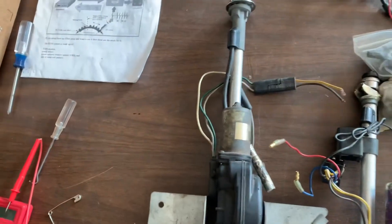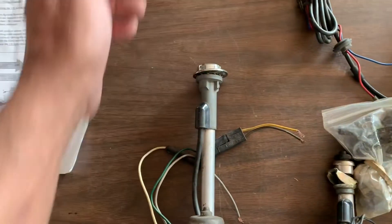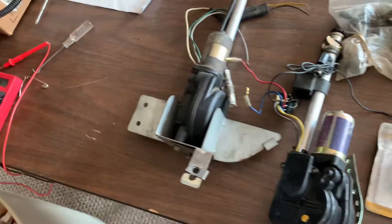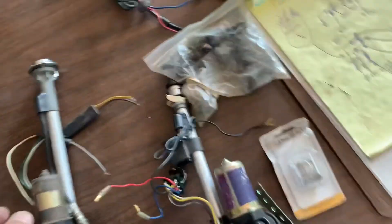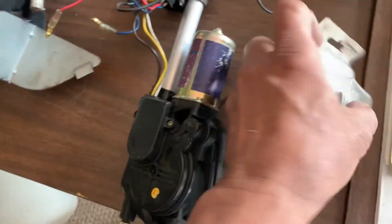I put one in the back of my Challenger where the T/A cars mount their antennas. If you have a car cover you have to unhook your antenna all the time. I like turning on my stereo and the blue wire makes the antenna go up, and when you turn off the stereo or listen to a CD the blue wire makes the antenna go down. You need to put a relay in place, just like these aftermarket antennas.